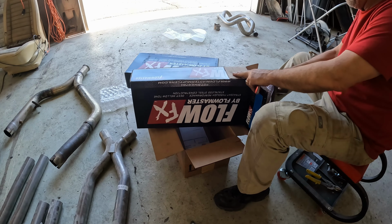I've got good clearance here. I'm trying to obviously minimize how low this thing hangs, but there's only so much I can do right up there. Raising, rotating doesn't really help a whole heck of a lot. So about where it is is about the best I'm going to get. And I do need to shorten my tailpipe now because I can bring that probably at least an inch farther in. So I'll cut off of this side. It's looking pretty good at this point.